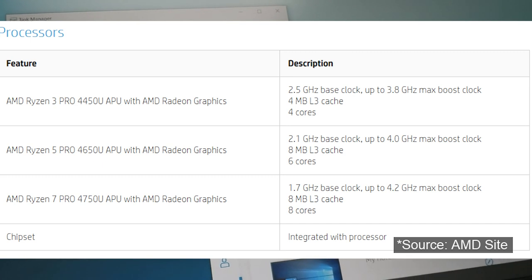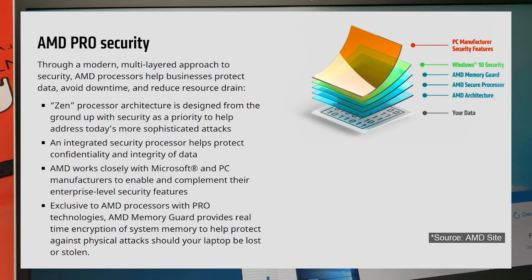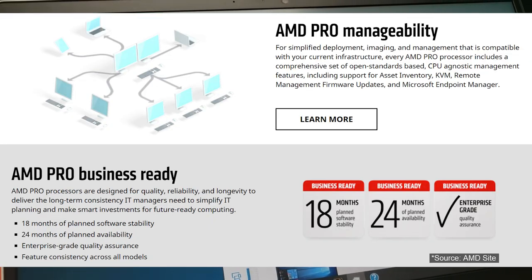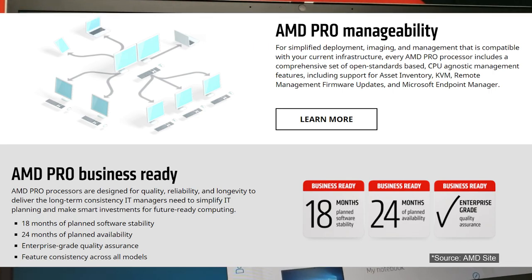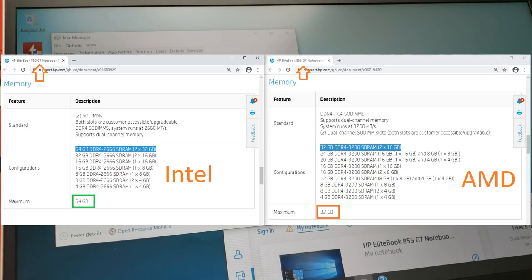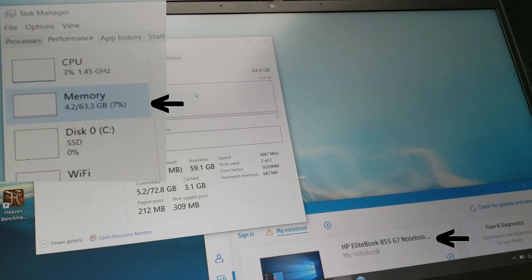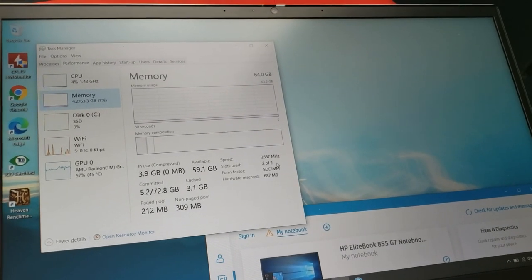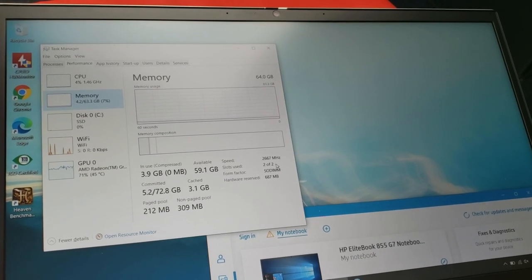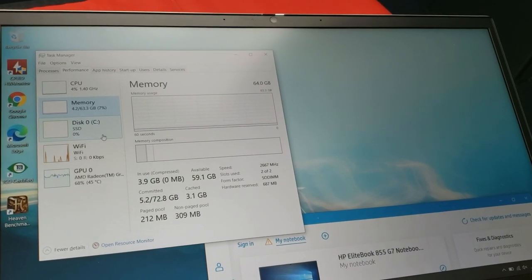Looking at the spec: with the Ryzen 5 you get 12 threads, and obviously there's an option for the faster Ryzen 7 with 8 cores and 16 threads. The Ryzen 5 Pro would actually be a very decent option for many people — more cores than the Intel equivalent and almost comparable single-thread performance. In everyday usage I don't think there'll be as much difference between Intel and AMD. HP only advertises 32GB of RAM support, but we've got 64GB running in HP's support system — so more RAM is definitely supported. This is 2×32GB; it probably can run faster if you put 3200MHz RAM in, as Ryzen is quite memory-frequency dependent.